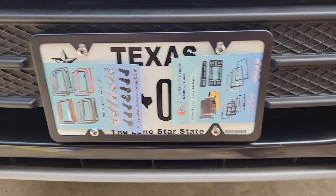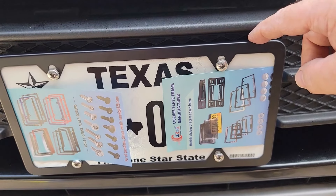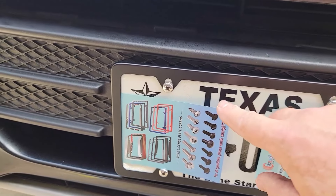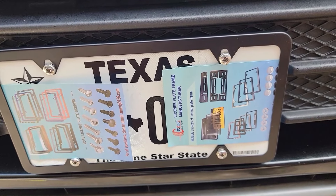So there's the bracket mounted on the front. I wanted to talk about these four screws here — you can see there's no rattle there, that's a nice tight fit. That's why I didn't put those foam pieces on the back, but every car is different. On the 2014 Ford Escape, this is how it mounts and what it ends up looking like. There are some little plastic caps that go on this — I'm going to put those on next — but that's strictly for cosmetics.